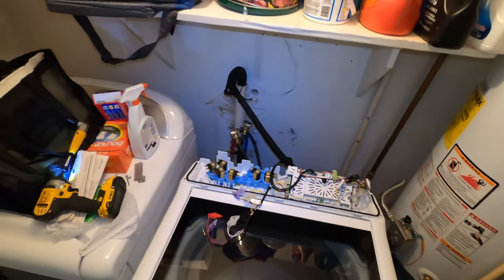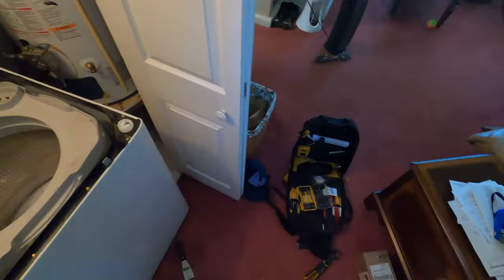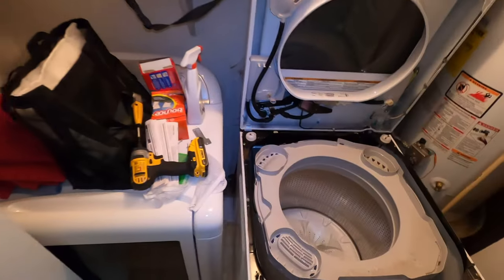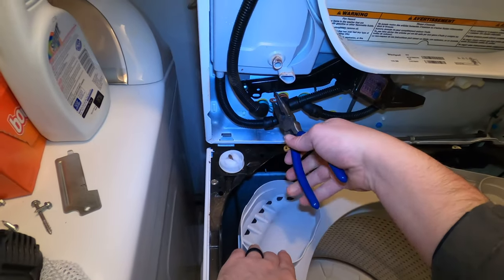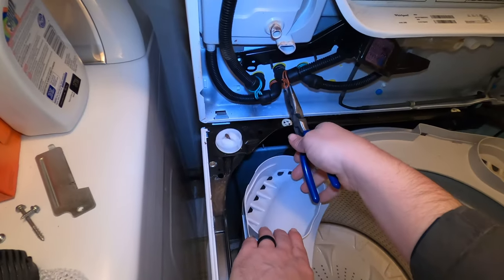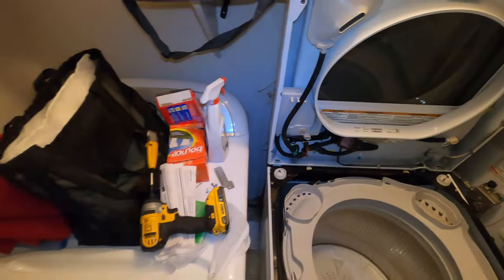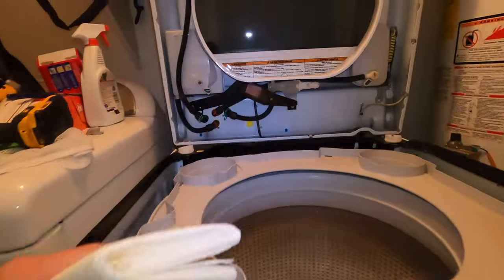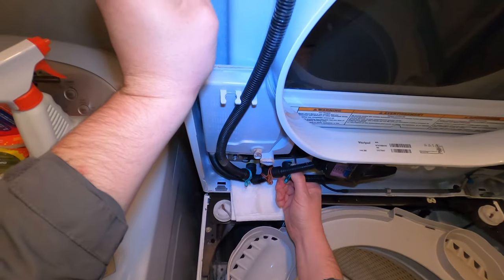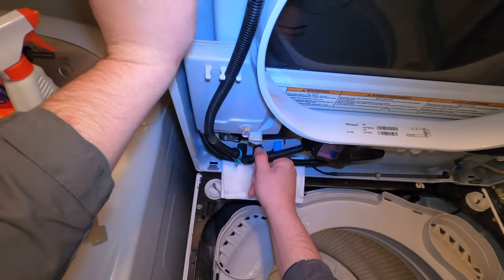This is the part I was talking about. If you lift up this top panel, that's when that lid's going to open and it's going to hit everything up there if you're not holding on — or if you hold it with your hand and then forget, that thing will spring open. That spring is powerful on that door. But this is the underside of the valve. All those valves — they got to go somewhere. So we got four hoses with hose clamps we're going to disconnect here. Keep in mind, whenever you guys take off these hoses, water's going to come out. So you want to get something underneath there to catch that water. Got the Bounty paper towels and they did a pretty good job catching all this water — the quicker picker upper.